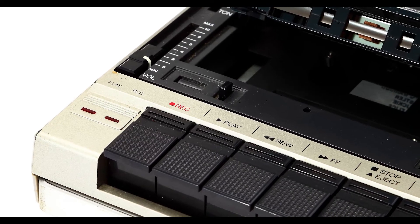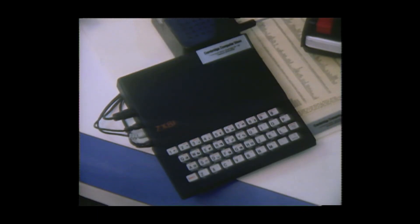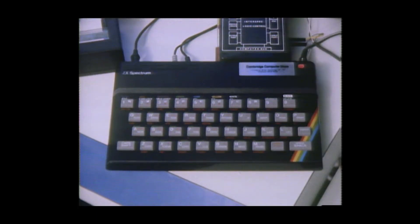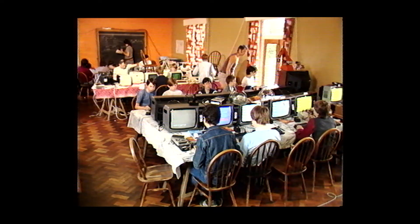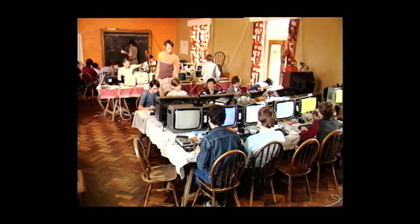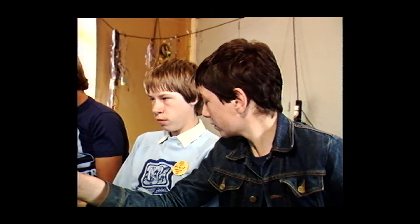The tape storage — it used cassette tapes for storing programs, and that had been a bit crude on the ZX81, so on the Spectrum that was much improved. You had headers so that the programs had names and you could look for the one you wanted. And this is a kind of accident, but when you're loading from tape there are lots of signals coming through, and we found that if you fed that through to the TV display, you'd get pretty patterns, but you could also see what was going on — you could see where the program started and which bit was the header, and it helped you diagnose what the problem was if it wasn't working.